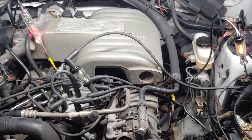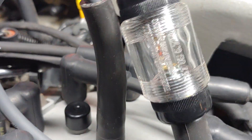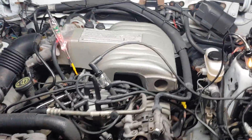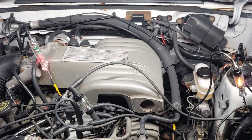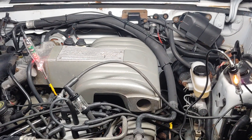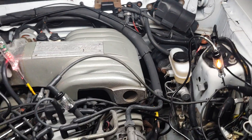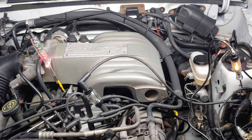So I'm going to crank this and watch how each one of these works. With that crank on this almost dead battery, I've shown you how to test pretty much everything to figure out why your car doesn't run. There are only two things we haven't tested: the PIP signal coming out of the distributor — which I don't need to test because we had a blinking light, meaning the PIP signal is actually good — and fuel pressure, which you need a fuel pressure gauge to test. That's the easy way to test a whole bunch of stuff.